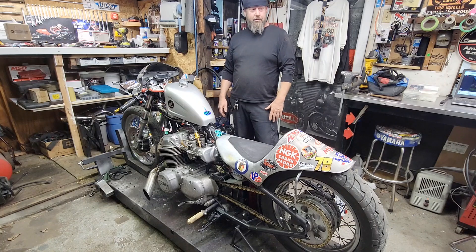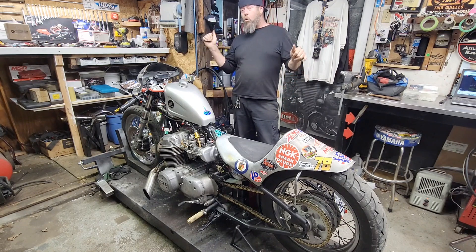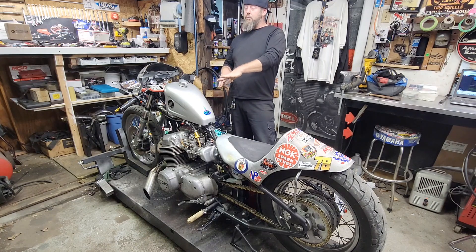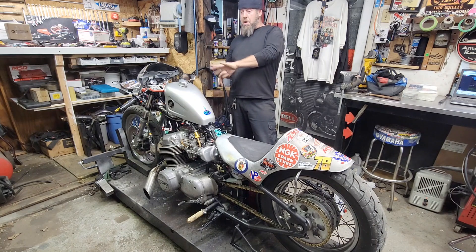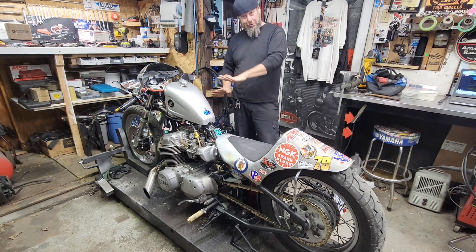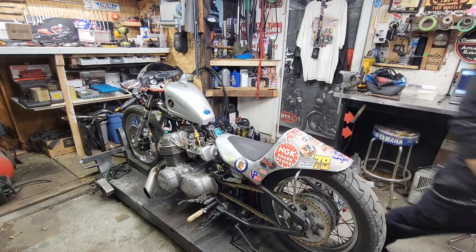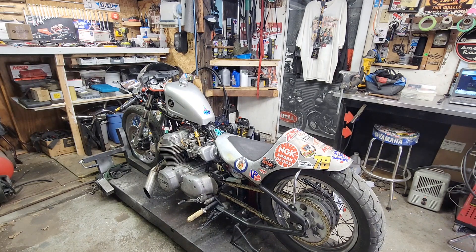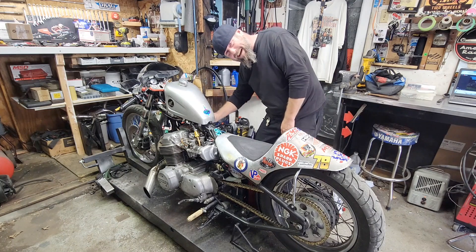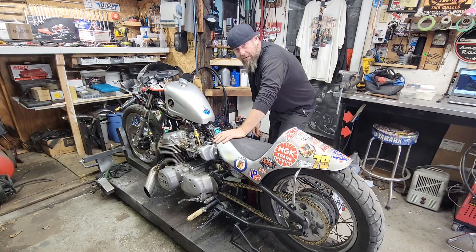If you guys want to hear, I'll light it off for you real quick. Let me crack this door shut, crack that one open. Leave the fan off for a second and we'll see how warm it really gets, cause it's gonna run a little rich on the two-step because it's misfiring cylinders — and that's what the smoke is, the extra fuel. It throws fire out of this thing like you wouldn't believe. We're trying not to do that — it's not good on stuff. When it does that it boosts the turbo to about ten pounds. Here we go guys — this thing is so nasty now I can't even believe it. I didn't even really think it was going to get this nasty.